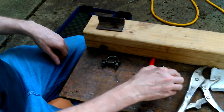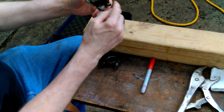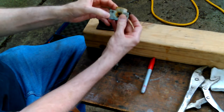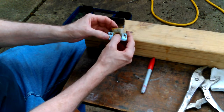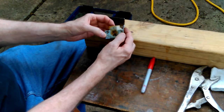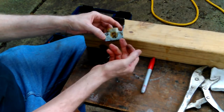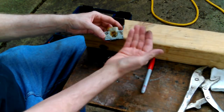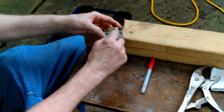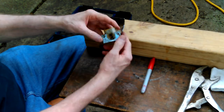Okay, now I understand. See, it was like this, and it wore out, wearing through the bracket. But see, there's a little hole in there that you stick that in. I told you to put some grease on there. Put that in the instructions. Put some grease on there, put the ball in there. And of course, they found that it's called a grounding ball, and it's actually touching the plate on the back side of the dryer.